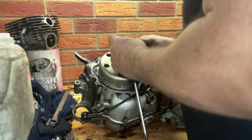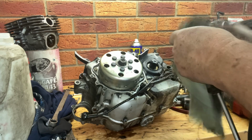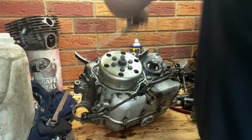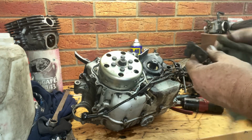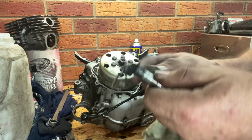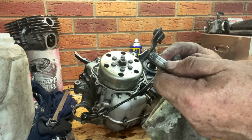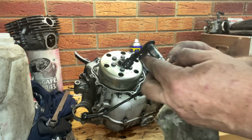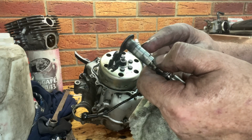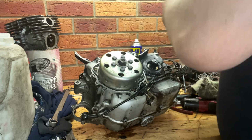I want to see the seal surface on this, because you can't really see it leaking until of course I put it back together, then it'll leak. There's really nothing to see. All that's above, that's where that screw went into there, and that's where the seal runs there. A little light buffing and a new seal, that'll be perfect.